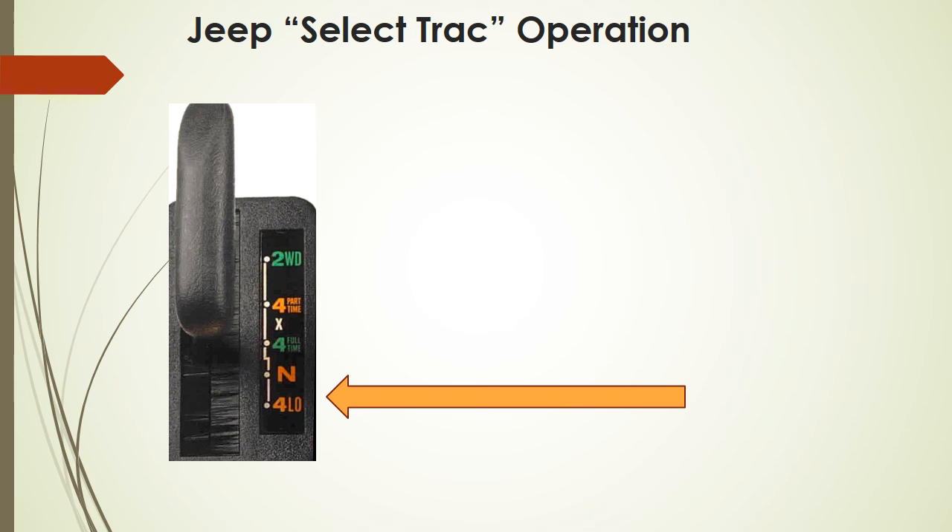Just put it in neutral and you're good to go. Four-wheel drive low range is for high-torque situations — it gives you about three times the torque you normally get. The actual number from Jeep is a 2.73-to-1 torque ratio. You'll also be limited to one-third of the speed. This is not the setting you'd use going to the market in a snowstorm — it's for going up very steep hills, bouldering, or pulling your buddy out of a mud puddle. It's not a range you'd use much unless you're a serious off-roader.